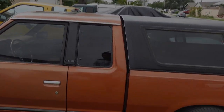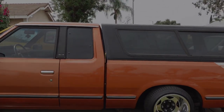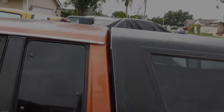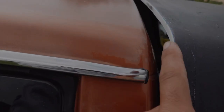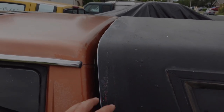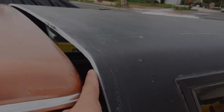Right here is what it's looking like — you can see now it kind of flows, it looks good. We also did a little bit of a bevel on there, a little bit of radius. Like I said we're still going to come back to this once we start to prep it for paint, which should be pretty soon. We just have to do one last thing before we take the windows out, and that is to make the little lip that goes on the inside so the seal can mount up to there — hopefully it doesn't fall this time.